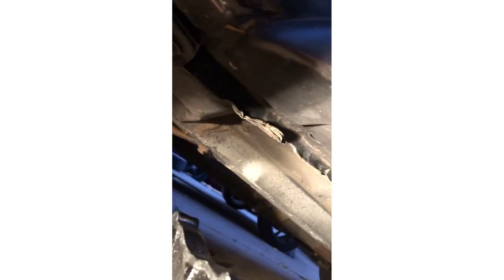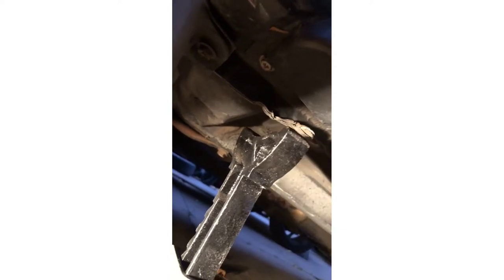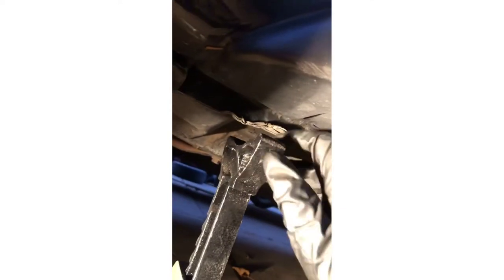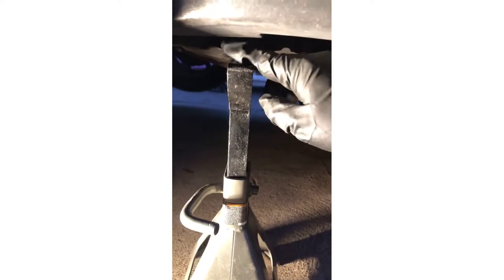You've got the car up in the air. I'm gonna place the jack stand right in there — it's a little bent but it's okay. I've been jacking up the car a lot of times. I measure with my finger. Make sure you have a flat surface where you place the jacks; otherwise they can fall, and that's no bueno. Make sure it's in that groove right there.